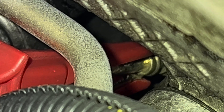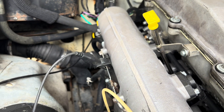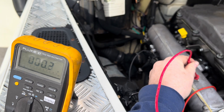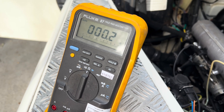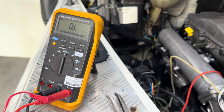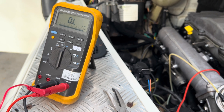We have a meter lead clamped down onto the glow plug way down there, and clamped onto a ground on the intake manifold. We have no continuity. As a sanity check, we verified continuity where we'd expect it — to the intake manifold and to the head — and we're still not seeing it from the glow plug itself. That confirms that power coming to this glow plug is good, but the glow plug has no continuity through it, meaning it's burned out and needs to be replaced.